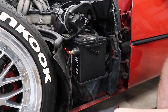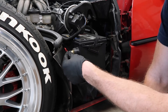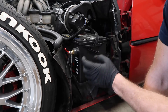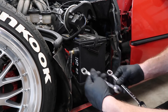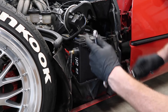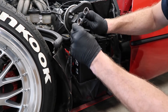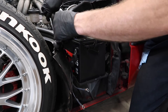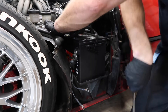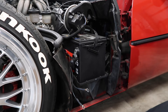Now with that panel off, the first thing you want to do is disconnect the negative battery terminal. Normally there's an 8 millimeter or 5/16 head bolt holding the terminal on. Because of my air ride system I have special stud battery ends for my compressor wires, so I'm going to take these off — negative first, then positive always — and same when you put it back together: positive first, then negative last.